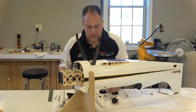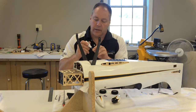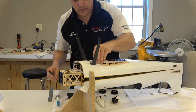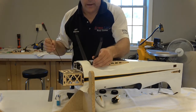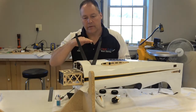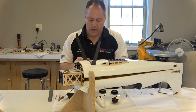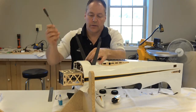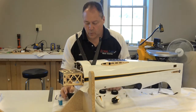So next I'm going to go ahead and put these four bolts in. I just put a little bit of blue thread lock on them and get them lined up. I don't put them all the way down — I leave them loose. Then I'll put the next one in, and I'll leave it up about an eighth of an inch. That way, if you've got to wiggle the gear and the alignment is just slightly off, you can work with it. That's just a little tip. I'll go ahead and put all four in and we'll come back to the next step.